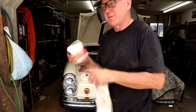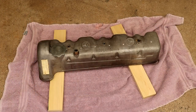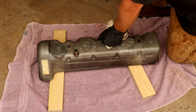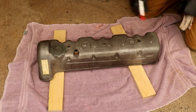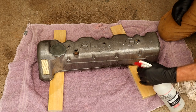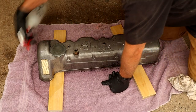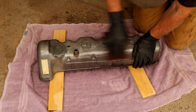I'll get it in some fairly warm to hot water in a spritzer bottle and see how it does on this cam cover. I've mixed up probably a tablespoon to a tablespoon and a half in a spritzer bottle - just going to soak it for a bit. It's pretty hot water so we'll just soak it, let that bite. I can do a little agitation with a little nail brush, and a little red Scotch-Brite just to help loosen some of the worst. You don't want to rub too hard because then you're shining it - just to agitate and loosen off the grimy stuff but not burnish.